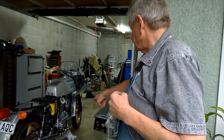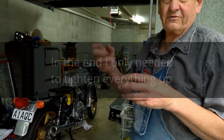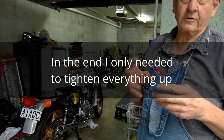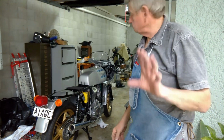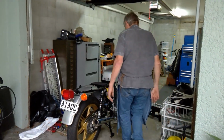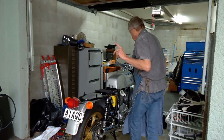On the crossover, you'd leave the clamp on the crossover and pull the header out, and do the crossover and then put it all together. Put a bit of stuff on the pipe, put it together and leave it overnight. Clean all the stuff off. It'll actually come off the chrome quite easily. Trust me, it'll fix that, even on the overrun. It fixes it like glue. Nice. Now, the other thing I want to show you.